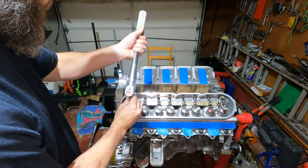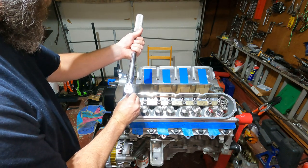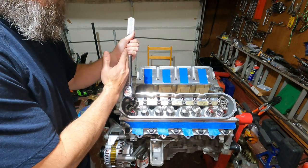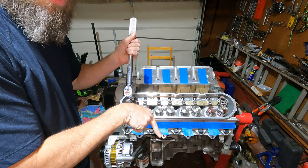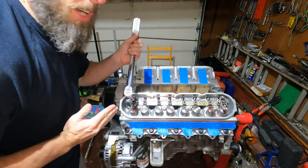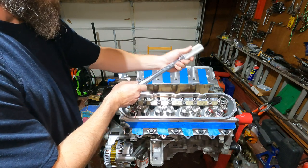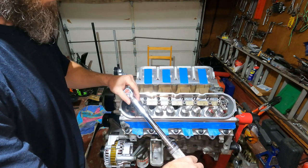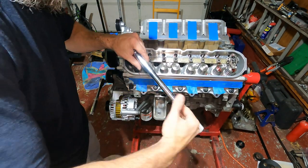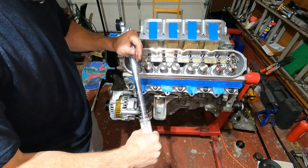So what you're gonna do is see if we get this to the 12 o'clock position and get it inside. There we go. So like I said, we want this to turn from here, go around to about this position, to like over here. So we should fall somewhere in there. So here we go, 25 foot-pounds. We're going, hitting resistance. So right there is probably about our 25 thousandths. So we should be able to get closer to 30. So let's go a little more.